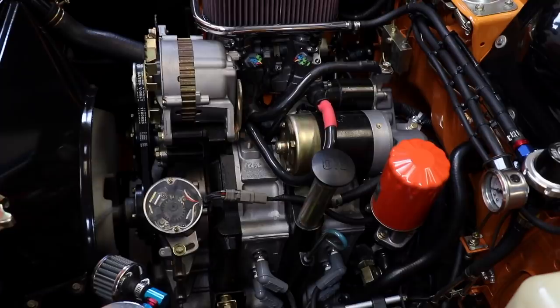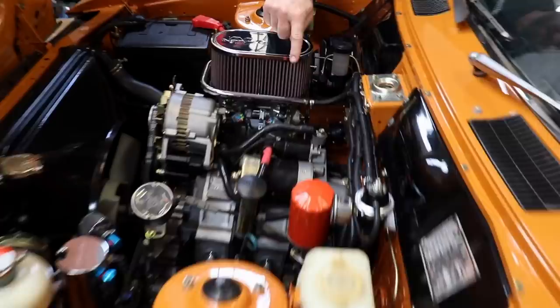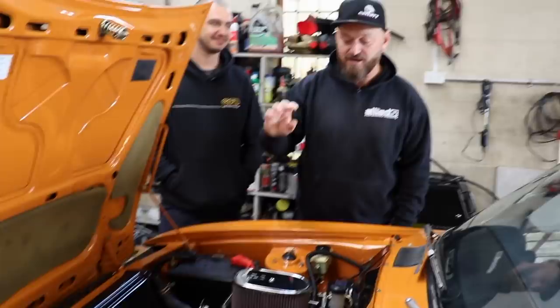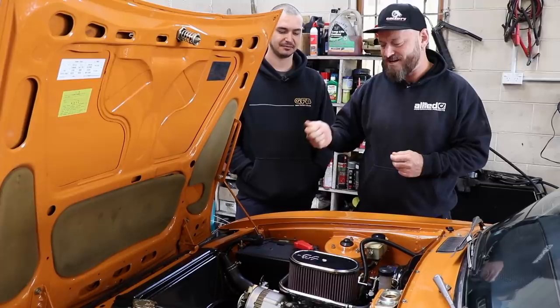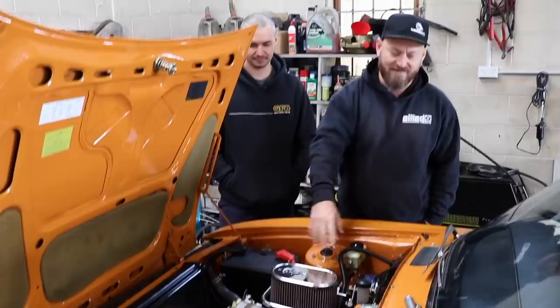It's got injection perfection throttle body with fuel injection, multi-coils. You'll see the big ass starter motor sitting on top of the engine. That's twin dizzy old school. They used to have a giant starter on them. Chi was telling me that was because they had huge apex seals, and even the early ones had twin side seals. So the engine had mass drag, and they needed a huge starter motor and big batteries to actually crank the engine over fast enough to get it to fire. So he's retained all that for authenticity, but upgraded it with fuel injection.